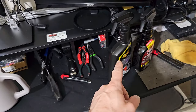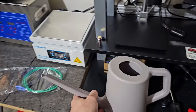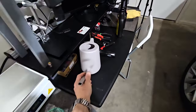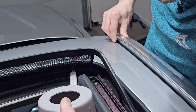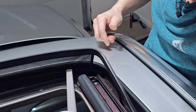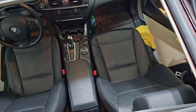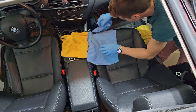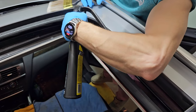Today I will use these cleaners and of course I need something to pour water on the drains to test them and after that to rinse the solution. I will start with this drain — I suspect that corner will start to leak water when I pour water down the drain. Now I will pour some water, and you can hear that sound — that means this drain is very clean. When I'm working on sunroofs I try to protect the interior of the car against accidental spillings.